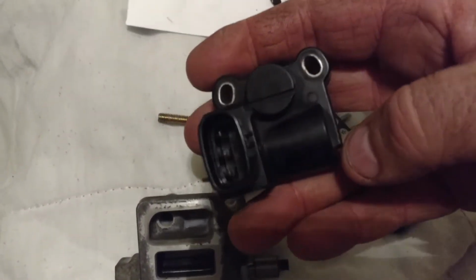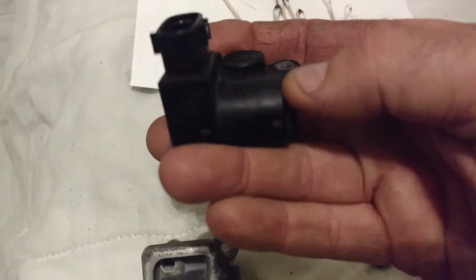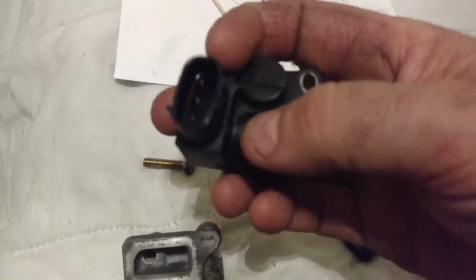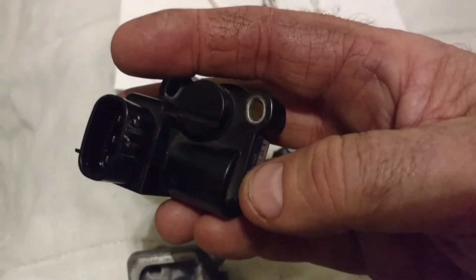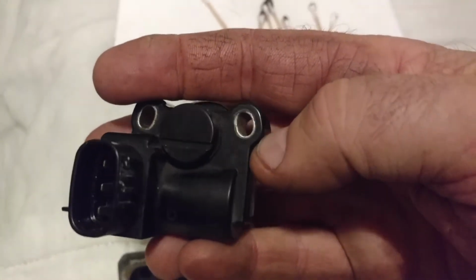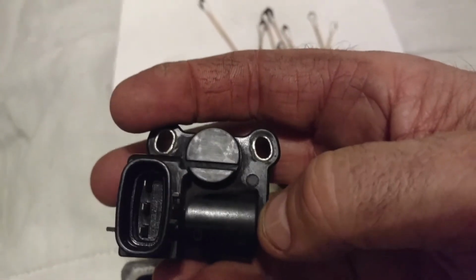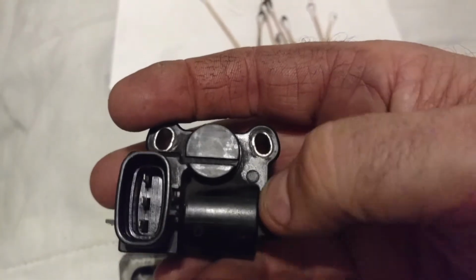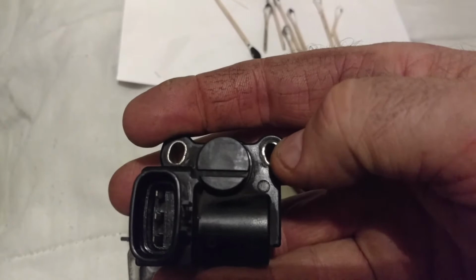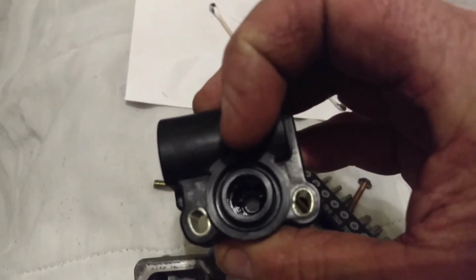Well, let's look at this molded body to see if we can make sense of some of this. This round part here looks to me like a coil or several coils of wire. And usually to magnetize something, they often use a built-up stack of thin plates of steel to create this path of iron that goes through the coil, comes up here, and then presents itself to the round hole where that magnet cylinder goes into.